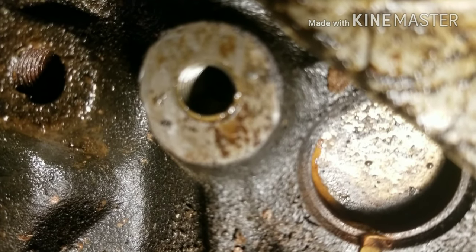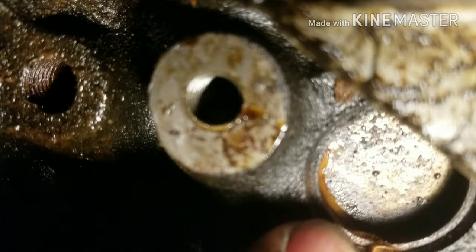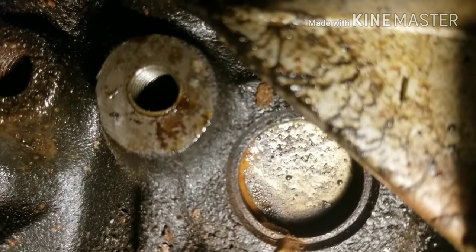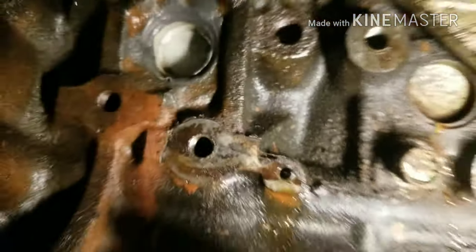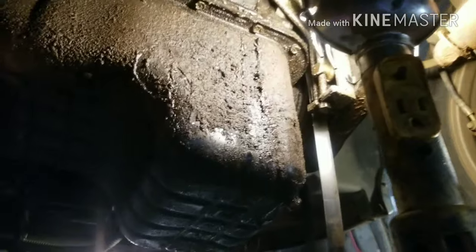If you get some more light, there you go — you can see the trail as it's coming down from there, on the side. So we're going to knock that out and put another one in. After taking everything out, to make this job a little easier, we've got the motor supported, because once you take that motor mount out and the frame and the bracket, then you have nothing really holding the motor on that side. And you don't want it to fall out on you, so you do need to have some type of support there.